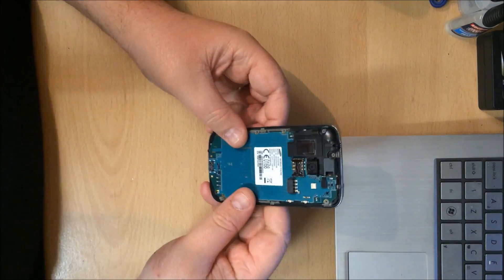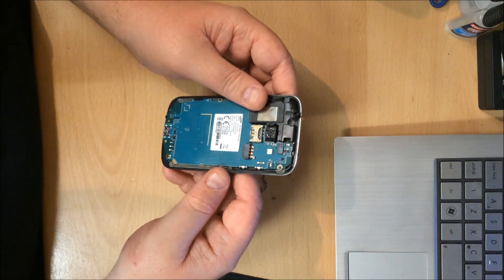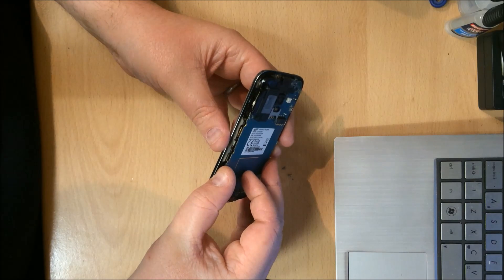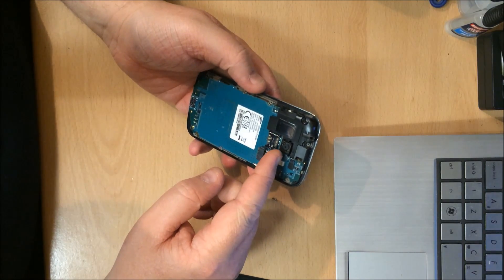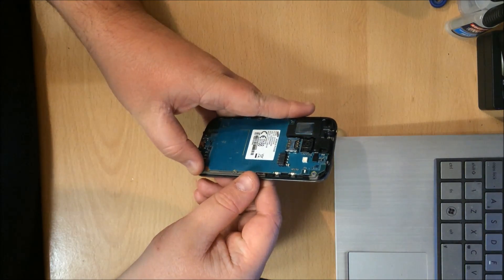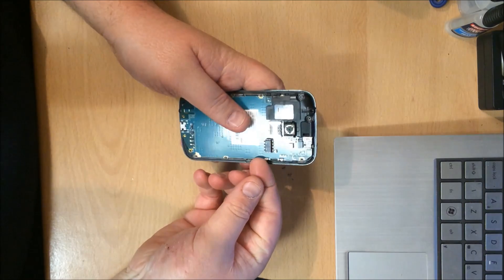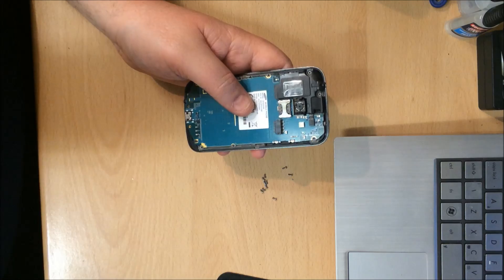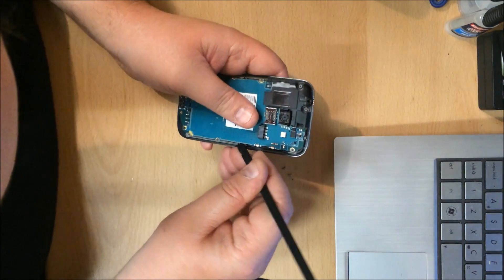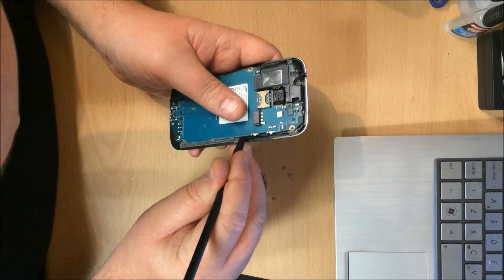We've taken the back frame off and now we've got the phone. You're looking for the LCD connector. I'm also looking to see if you have to disconnect the loudspeaker. Just very gently lifting the board to see what's connected underneath it. Once you move the board, the camera and loudspeaker will come out together and the LCD connector is about here. So you want to open it up like a book — like you're turning a page. The board is held in by a little tiny clip.